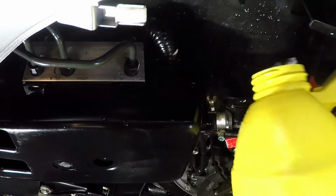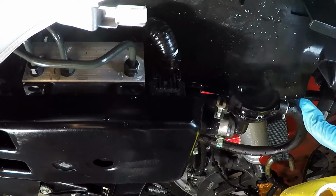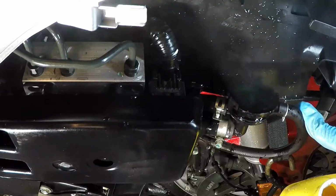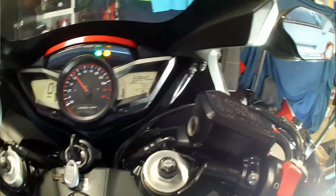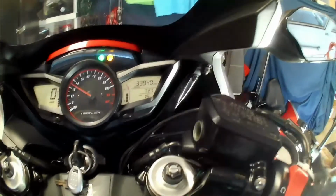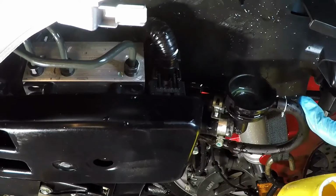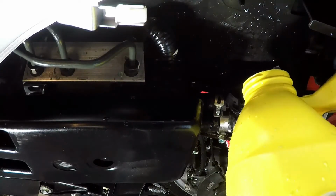This bike actually had 2 distinct air pockets released, and once this was done, no more bubbles were visible in the coolant. To make sure you have eliminated the air, your coolant needs to circulate. Now this is done when the engine is hot and at normal operating range. The radiator fan should be on and working. If the fans have not kicked on, the engine isn't hot enough.